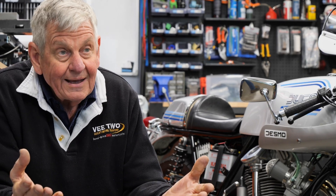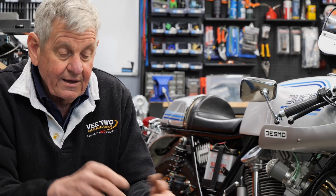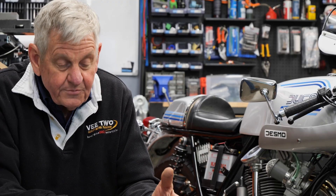I can quote so many engines that don't even run an oil feed to the big end. The Laverda triple, for example, has no pressurized oil from the oil pump to the big end — not one drop. No oil through the crankshaft. Nothing. It relies on mist and a thing called a slinger. The slinger collects the mist and flings it out to the outside and feeds it in. And here's an interesting fact: Laverda triple crankshafts do so many miles — they just keep going, they're known for it — and no oil feed from the oil pump as such to the big end.